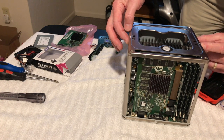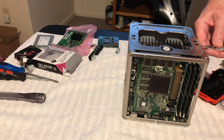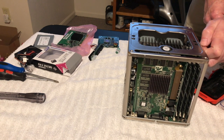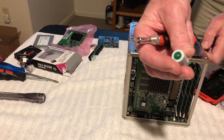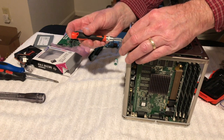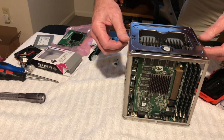And then I gotta take these out too. And there's a reset switch on this on the inside too, a power management switch too. I was doing some reading on it, and I'm gonna reset that too. And I also took the PRAM battery out of my slot loading G3. This is a new battery because I'm gonna stick it in, and all these things, and see if it makes this proximity switch work like it should. Hopefully it will. So these are real long here on the sides here.